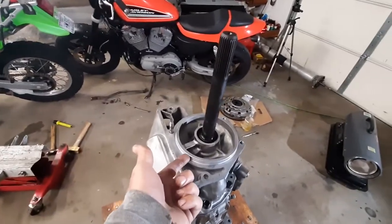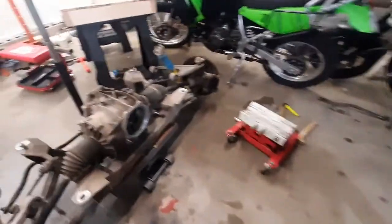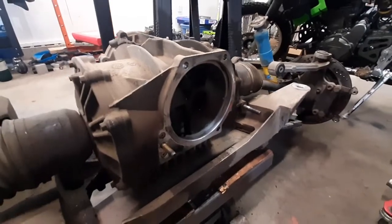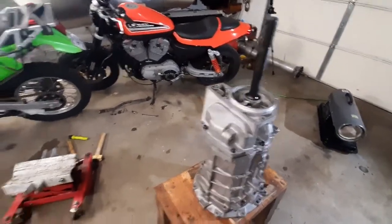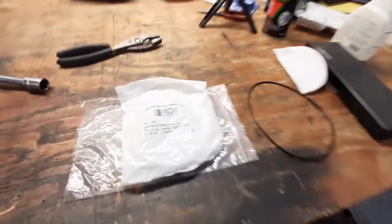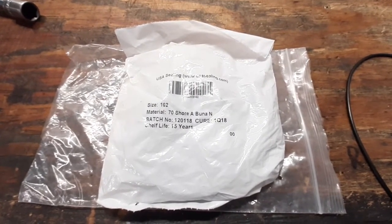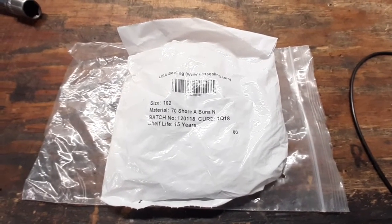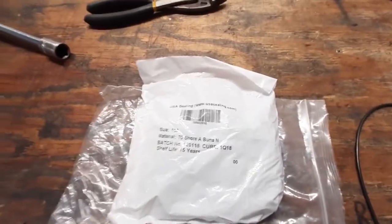Right now we need to put a new o-ring on here, and we'll put a little silicone around the flange where it mates up, because that's how it was from the factory. The o-ring should do the job; a little silicone won't hurt anything. I think you can still get the o-rings from GM — I just sized them out and bought a package from a parts store. They're a size 162 o-ring, so if you want to go that way, the whole pack was cheaper than getting one from GM.